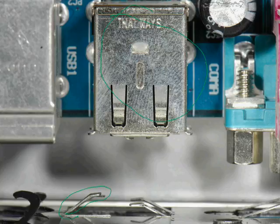But a lot of the I/O shields now, especially from ASUS, which is the motherboards that I've been buying lately, will have this whole I/O shield. It'll be kind of a padded foil item. There's like a padding under here, and it's much easier to line up, and it's much more forgiving. I don't have to worry about bending prongs back and forth and all that kind of stuff. But just test fit this carefully before you go around jostling too much there.